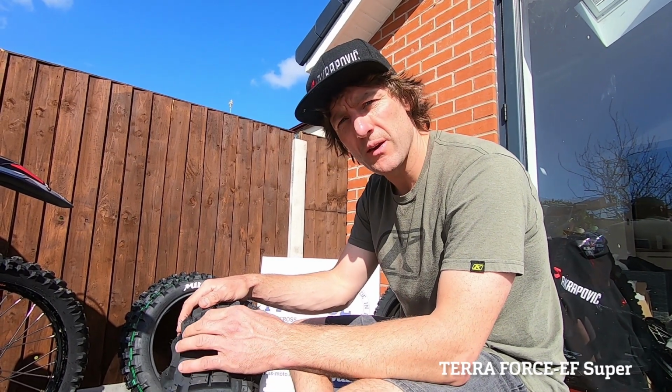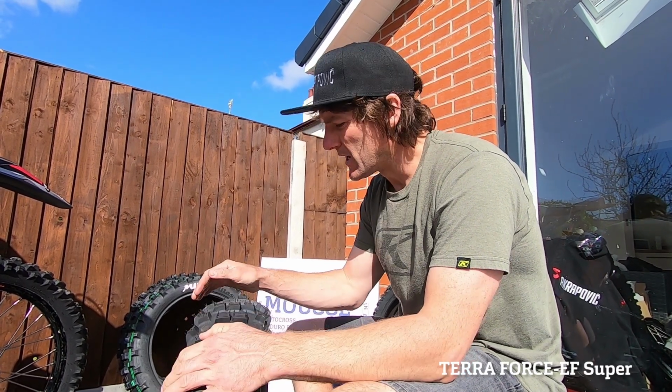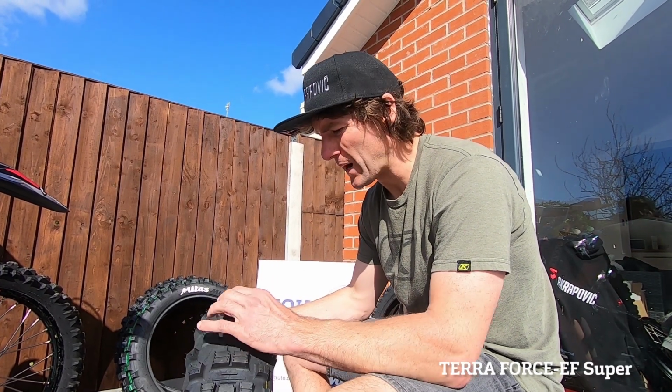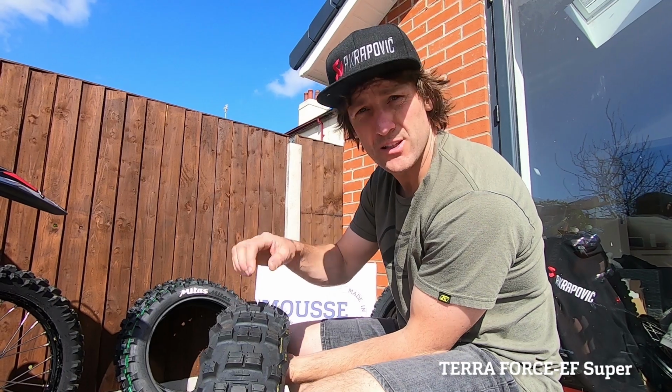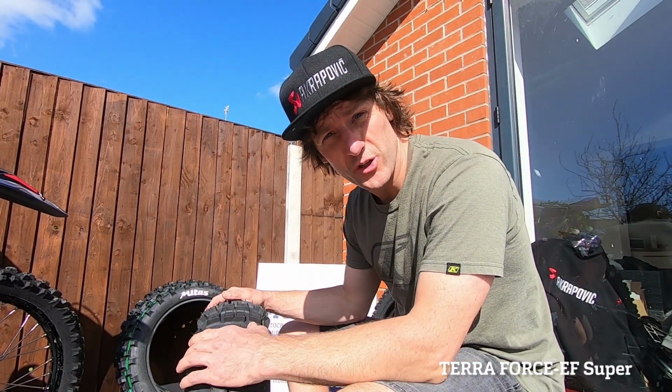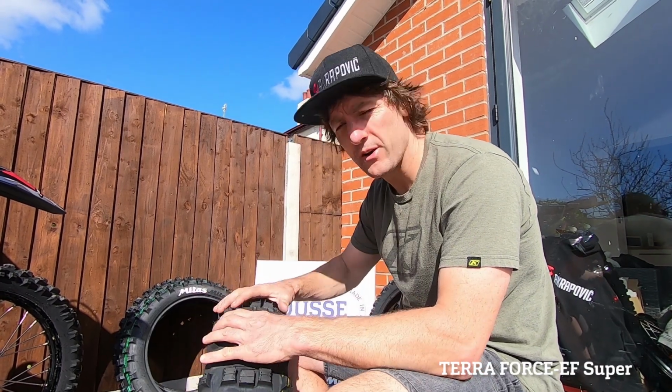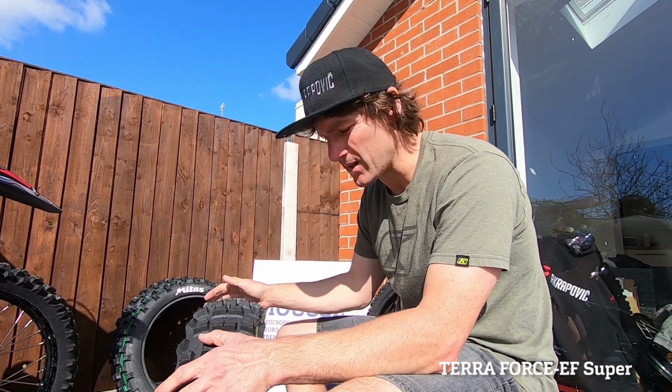Or the Trefle, if it was really dry, and then like I said, if the Trefle was a little bit wetter, then you'd go for a slightly smaller mousse inside, or maybe just a more used mousse to get a little bit more tyre spread on the floor, so you're hooking up in the straight lines.